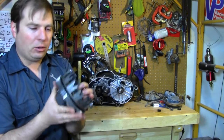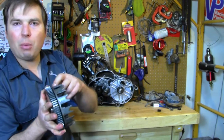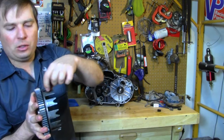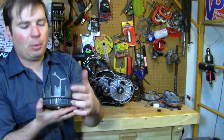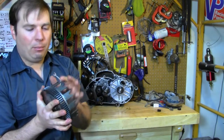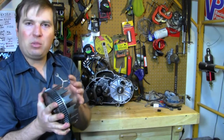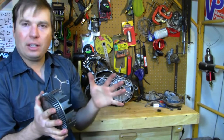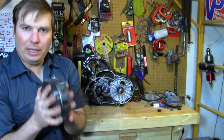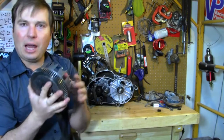What we're going to do here — and it's a little trick I've picked up over the years — is I'm going to polish up and clean up the surfaces where the fiber plates run, shine them up, make them real shiny and smooth, so that the plates won't catch when you release the clutch, and when the plates can't move a little bit to release their friction to allow you to change gears or stop at a stoplight.